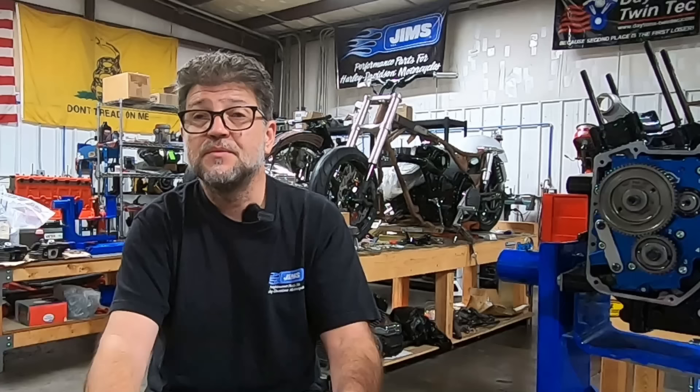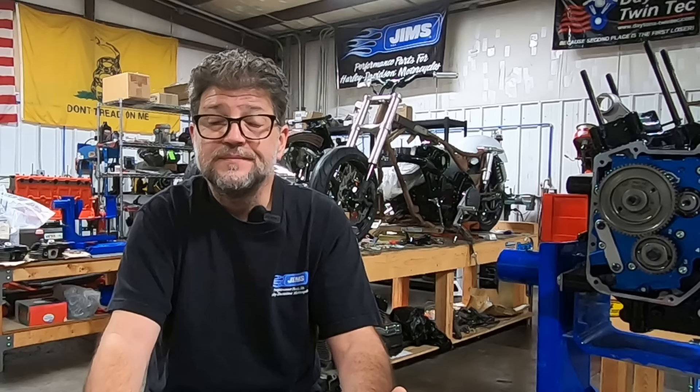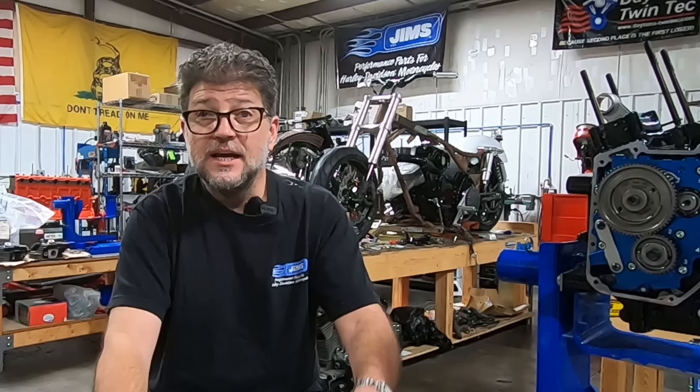By 1992 and 1993, the problem was much better, and from then on up into its final production year it kept improving. Harley owners also saw the introduction of fuel injection in 1995 with the Magneti Marelli systems — hated by most people. I actually always found that in the right hands, the Magneti Marelli systems ran just fine. Evos occasionally would also have low oil pressure issues, resulting in a noisy top end because the lifters couldn't stay pumped up.